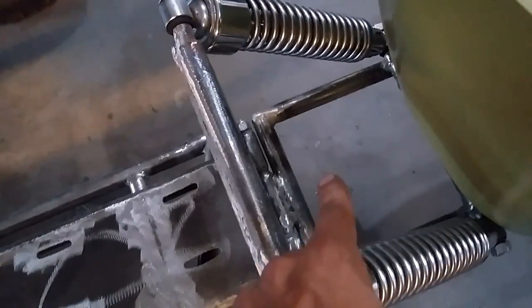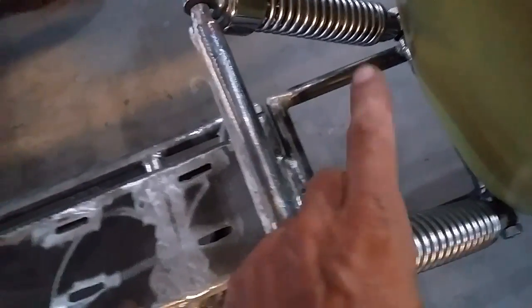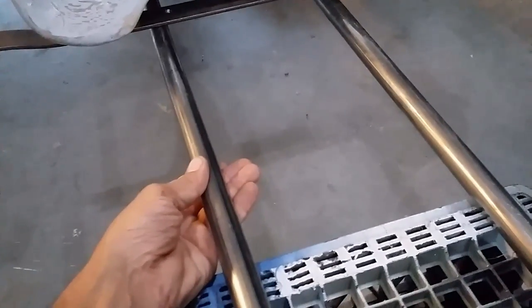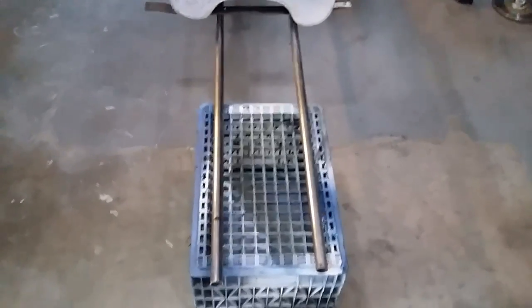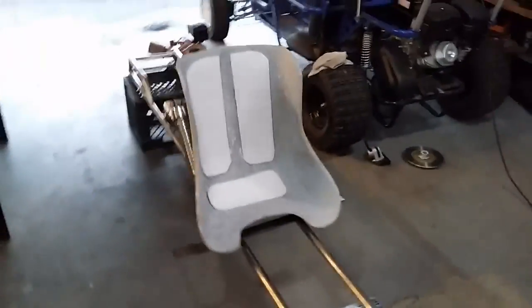In this area back here that's empty, I'm gonna do another video where I build a box for a small 12-volt battery to run lights for this cart. After I get the seat on, I'm gonna put a flat skid plate on the bottom going across with a couple more supports, then come up to the front end and start putting in the steering. I'm also going to put independent suspension on the front end.